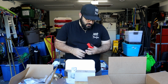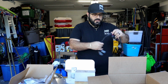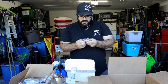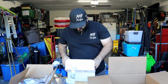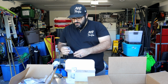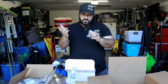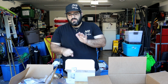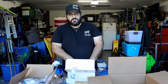So I can't wait. And this kit is pretty complete. Well, it is complete. It's plug and play. Comes with the harness all ready to go, and it even comes with the reverse plugs. Again, couldn't be easier than that. So all you have to do is take out the electrical pins from the standard connectors on the Miata, and look at the instructions online that they have, and you just put them in where they're supposed to go. Plug it in on the ECU. Put the dwell settings that they recommend to use with these coils, and you're good to go.